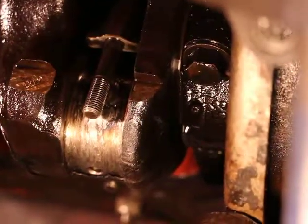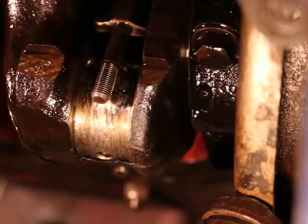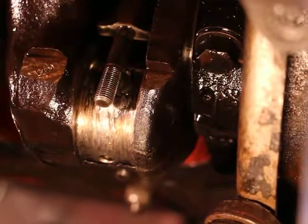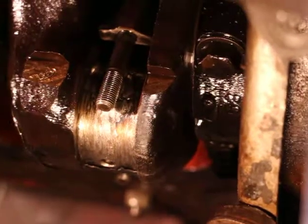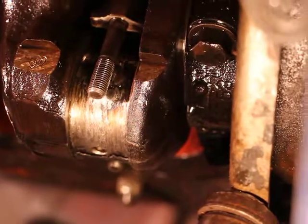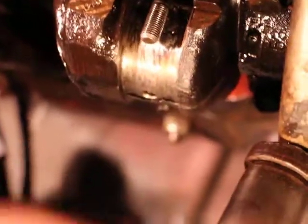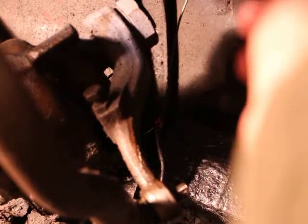But I will have to remove the piston through the top, so I will have to change the head gasket as well. Probably have to buy a new gasket, or might be able to reuse the one I had, since it's actually new. But it's another bit of work, and I'll have to wait for the bearings to get here. So that's what we're gonna have to do. And of course, we'll have to put new bearings on the connecting rod, right? They're two halves of a circle, right? Let's see there. It's a little bit left, but it's supposed to be a complete circle. It just isn't.